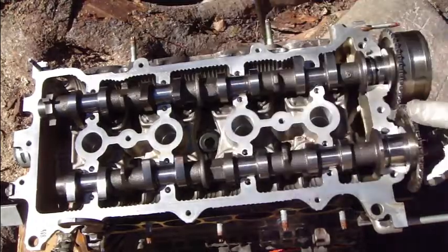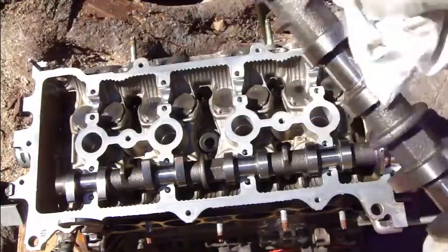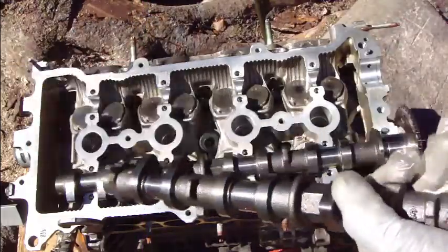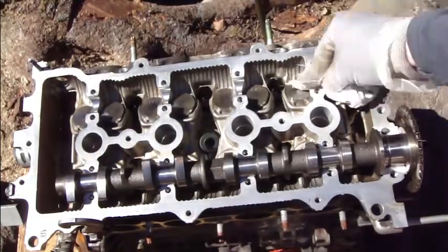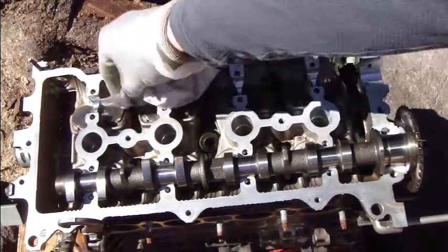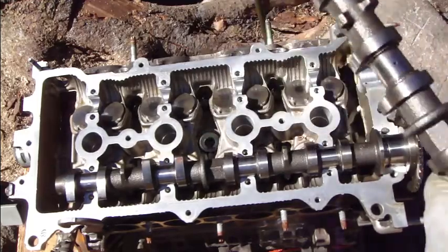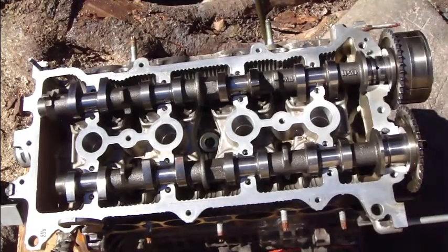This is the exhaust camshaft, and there is this intake, and also here all the oils away from these parts. Then the bearing plates must be very clean, and it's good to take away all extra particles that are in here. And then I install this camshaft in there.